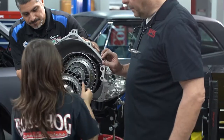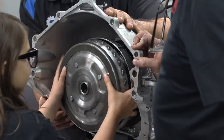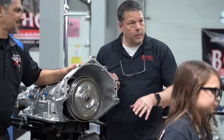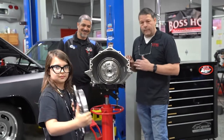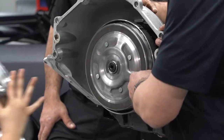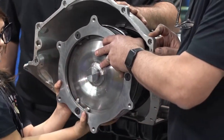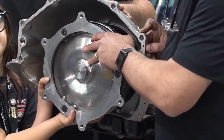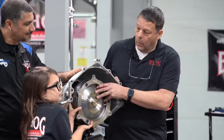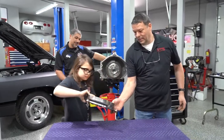Now we're going to go on with the turbine — it's a much snugger fit because of the O-ring. That's a thick O-ring that the 4L80s have. That's just enough to pull it back and meet the flex plate with the proper spacing. Every single one of our torque converters is stacked out on a transmission to ensure fit and fitment to make sure they go on right. This is the front cover in the bottom where this piston is going to line up and put your lock-up on. Normally it's all welded together. Thank you, Nora — you've done an awesome job. Now let's put the real torque converter in this transmission and put it in the Cadillac.